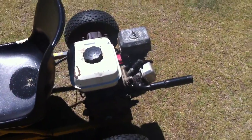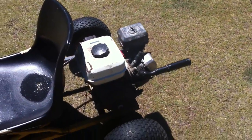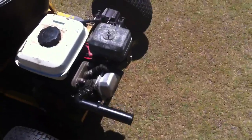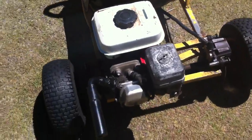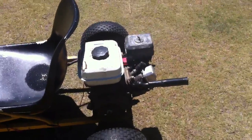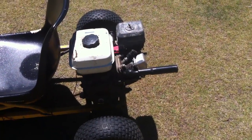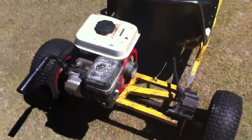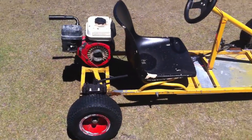Now this engine is a Honda GX120, it's 4 horsepower, although I've done a few little mods to it, like removing the governor — which is not really recommended if you're not experienced with engines. I've got a three-stage header on it, not as loud as a straight pipe but with just a little bit of restriction. A few other little things, and this probably pushes about 4.5 to 5 horsepower now. For a go-kart, engine-wise, you probably want about 5 horsepower upwards — below that you're going to bog out a bit. I don't weigh a lot, probably about 60 kilos, so it's alright for me.